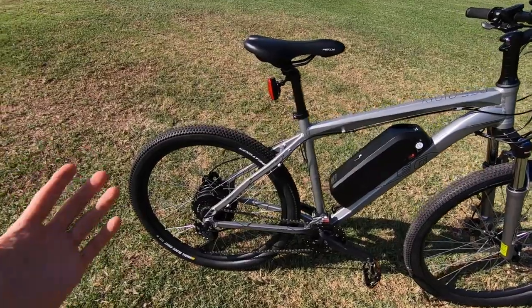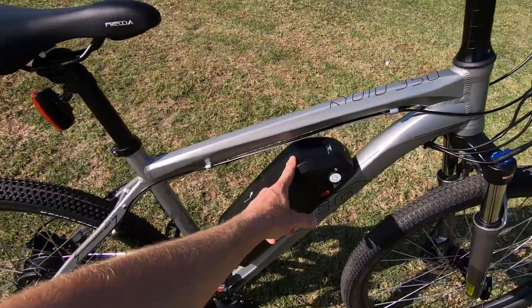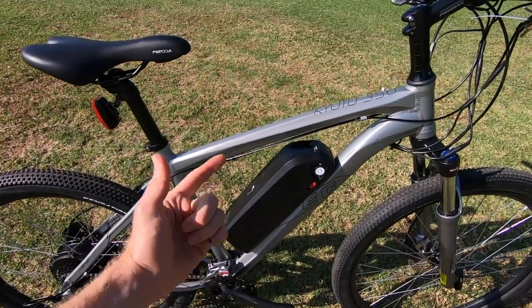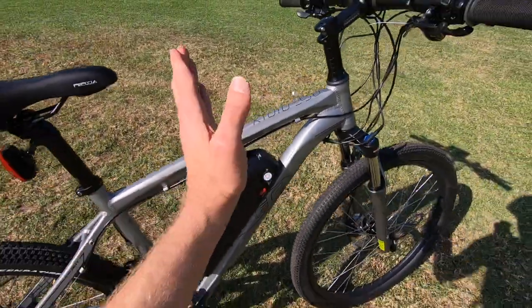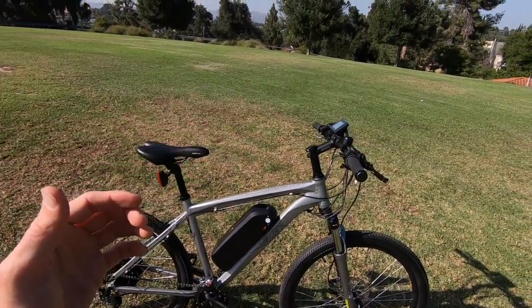It's a little more complex and a little more weight — 52.5 pounds for this entire bike, and 8.5 pounds for the battery. This is using generic lithium-ion cells at 2,600 milliamp-hours in a 48-volt, 13-amp-hour pack. That's pretty good. The weight is low and centered, but it's just bolted on versus some of the newer bikes where it looks more integrated.